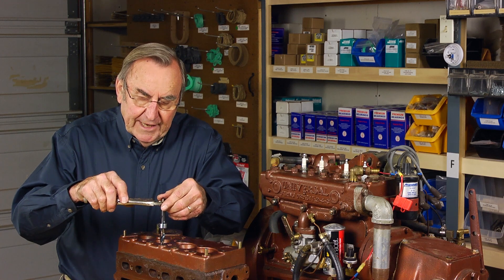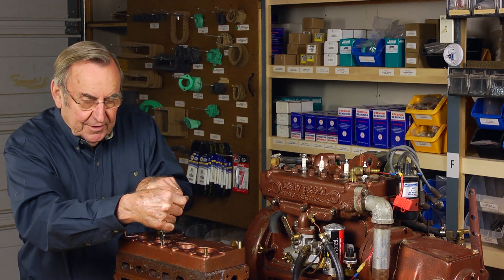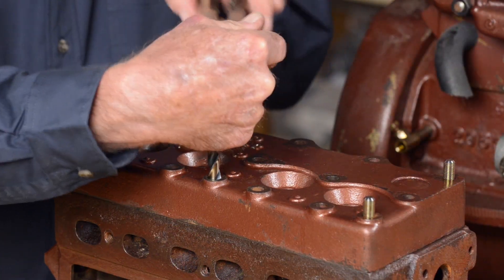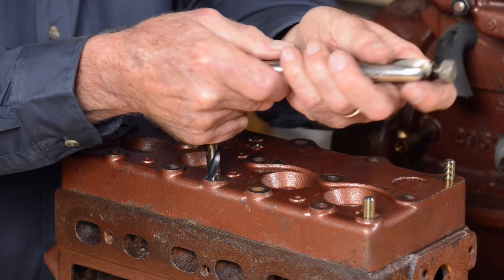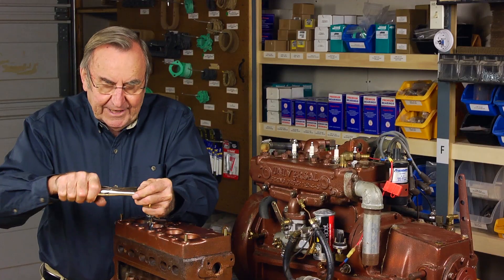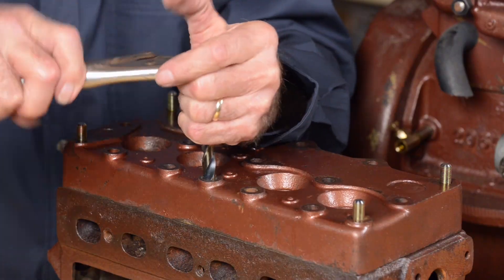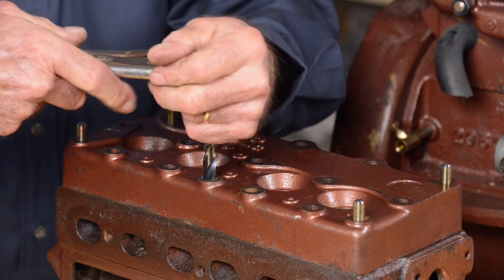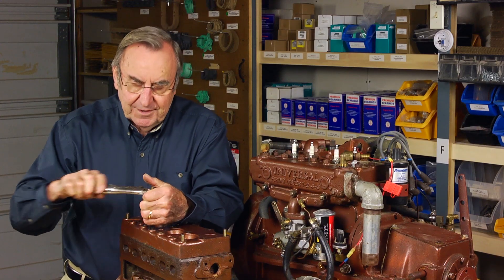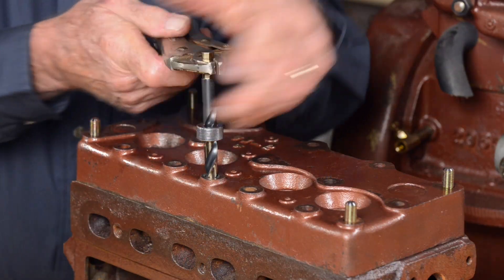With the stop ring securely set, we'll be reaming this hole now all the way through the head to the stop ring. Many people express concern that we're somehow violating the head by increasing the size of this hole, but the hole is already just several thousandths under the 7/16th inch. So we're reaming the hole very slightly over what it was to start with. I'm using the vice grip as a hand reamer because most of the time, if you're doing this on a boat, you won't have space to use an electric drill anyway.